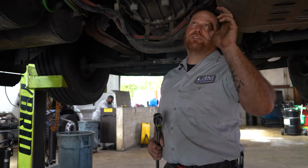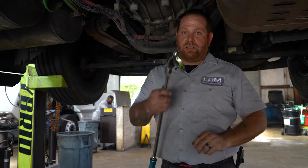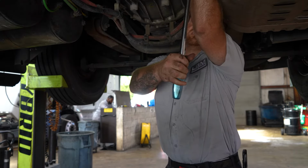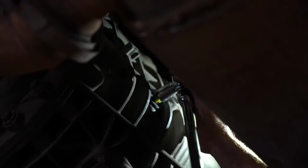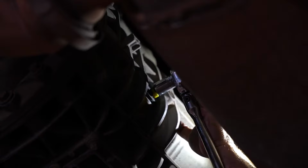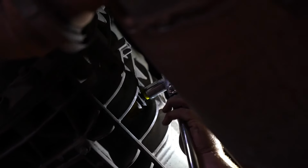Right now we're on the passenger side. The fill plug is right here, so that's where we're gonna insert our tool. And when you put it in there, you can do 1 or 2 things. You can go slow, or sometimes just pull real fast, like just jerk it so you can pop it free and then start spinning. Once it does that, it should start freeing up. You should be able to do it with your finger. So just like that, I am taking it off.